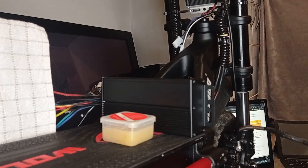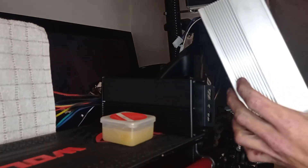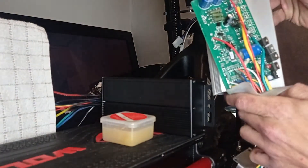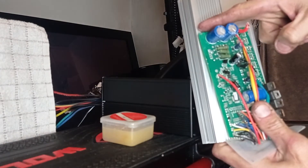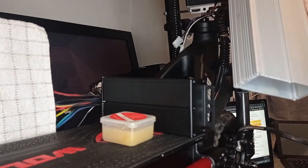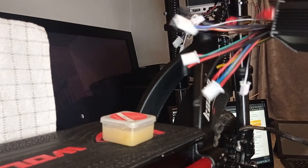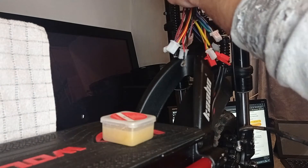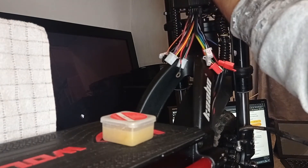So to recap: we've got the silver block from Amazon for £24.99, we took the PCB out of the case, got our shiny case, cut the last two inches off — best way to measure is along the side, give yourself about 5mm breathing room, cut and spray it black. Now we're mounting it on the Kaabo using cable ties, just securing it onto the one that's already there.